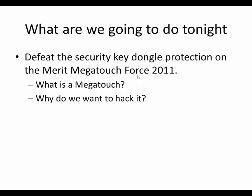What's worse is that these keys — you have to have the data that's on the key to play your game. They have a battery in there that holds the data, which is actually encrypted. And when the battery goes bad — the company that makes the battery is called Maxim Dallas — their spec sheets say the lifetime of the battery is 10 years. So if you have a Megatouch from 2005, your battery is already over its due date. When the battery dies, the data on the key is no longer accessible, and you can't play your game that you own.